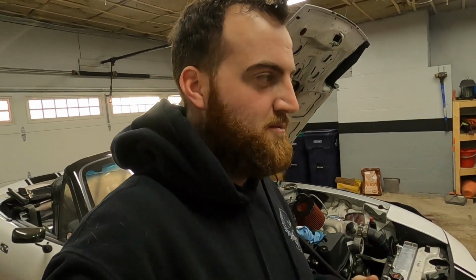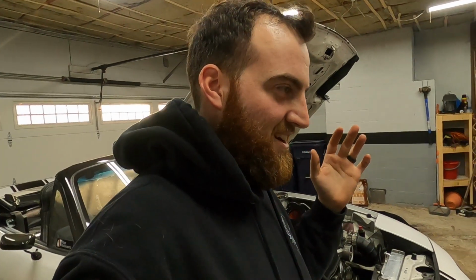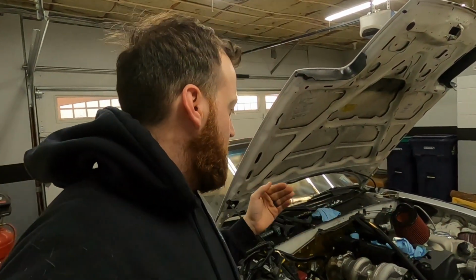This is the tricky part because you're not just building off into space. You now need to connect it to another spot, and you have to be spot on. And I also need to allow for some room of adjustment in the whole system. So I gotta play around with it. I have a lot of stainless. I don't want to cut a lot of stainless because I don't think the bandsaw is gonna hold up to it. So I'll take this off. I'll show you guys what I'm talking about, and then I'm gonna probably put you down while I cut a bunch of stainless and figure out the right piece, because I won't be happy until it fits right.